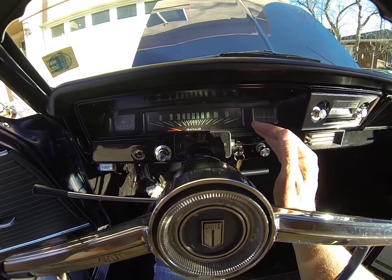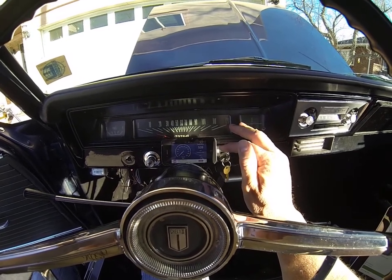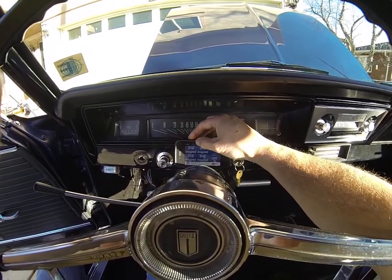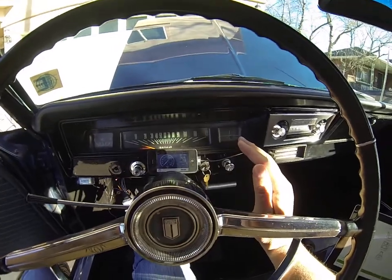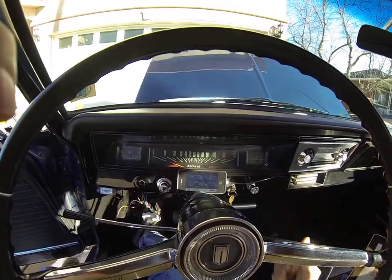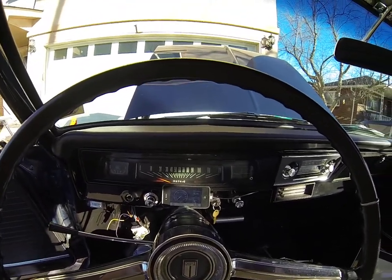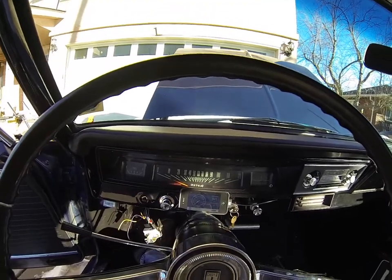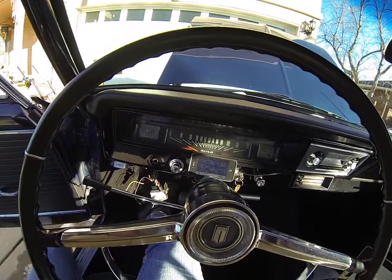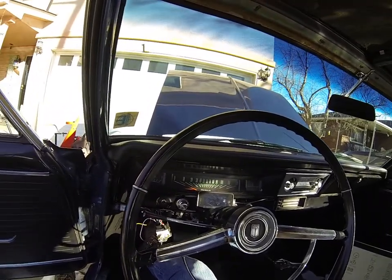You just hit Dashboard, and this is the dashboard I have set up for this car — just a speedometer, RPM, and coolant temperature. There are other gauge pages as well with the same kind of thing. That's the way you hook up a digital dash. This works great. The speedometer works by GPS, and engine RPMs and coolant temperature work perfectly. If you ever want to get an LS motor put in your car, this will work for LS1, 3, 6 — any of the new OBD2-type motors — you can plug this in and basically go. Thanks for watching!